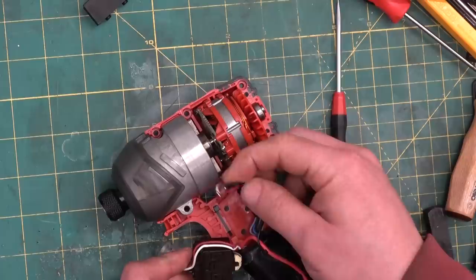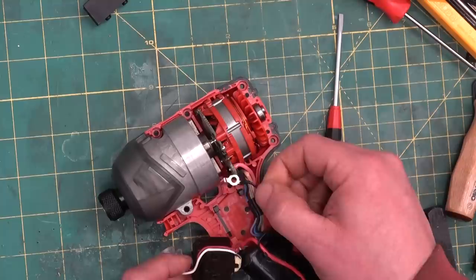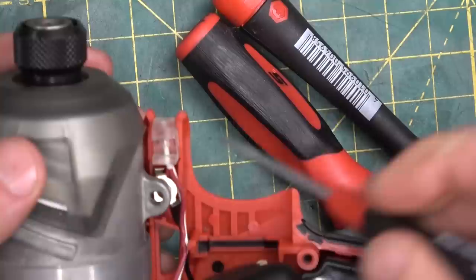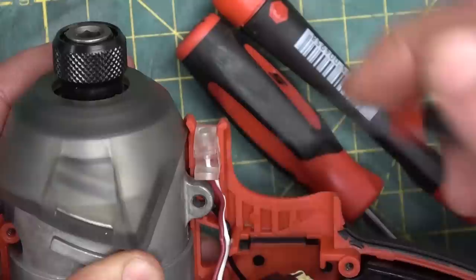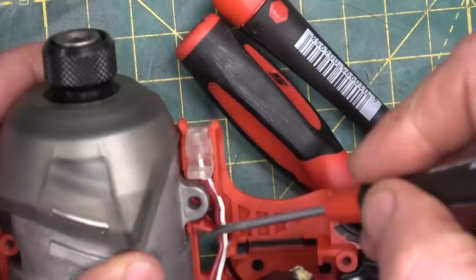There's something we haven't seen before. It's a high-voltage bleed-down — we've seen it on hair dryers and things that move air. This is a ground — it goes in the casement. It's not attached to any conductive material but it is attached to the case, so that's got to be for very high voltage. Actually, it does ground to the case — maybe to protect the bearings — but then if they were worried about the bearings they wouldn't make it ground through the bearings. It must have something to do with the fact it's a brushless motor changing the magnetic field quite rapidly — maybe some hysteresis or some eddy current — creating high voltage that they want to dissipate. Unfortunately my scientitious smock is at the dry cleaners.